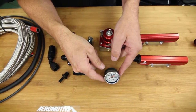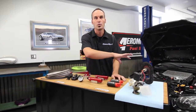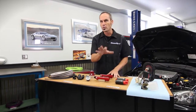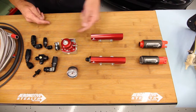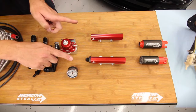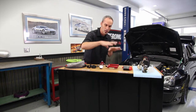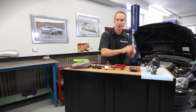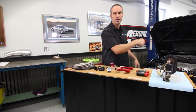Everything you need to plug and play — you literally pop the pump in, don't change anything, and when you get up to the front, you've got some adapters for your feed in and your feed out, and you're done. A cool upgrade they do is they actually go from a series — fuel coming into one rail, into the other rail, and back to your tank — to actually doing it in parallel. So you come in with a Y, split them back together on the other side, separating the two halves. Your fuel flow lowers as far as speed per rail, a little bit better dynamics, lets the fuel turn into the injectors, then brings it back together, tying back into your stock system.